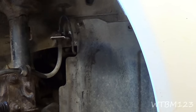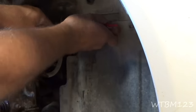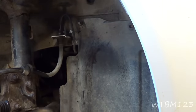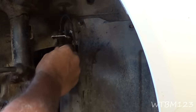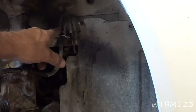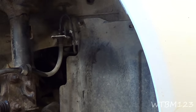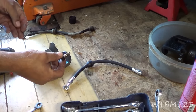Now let's get this brake hose off. I get a screwdriver behind here and these clips usually come right off — that's all you've got, just a little tin clip — and then the line will be loose. I had already broken this line loose before. Put the cap back on the master cylinder and have something to catch your fluid in, because you are going to lose a little bit of fluid until we get the new line on.